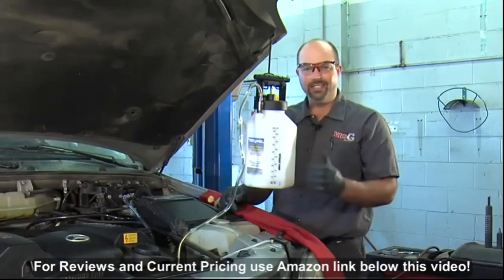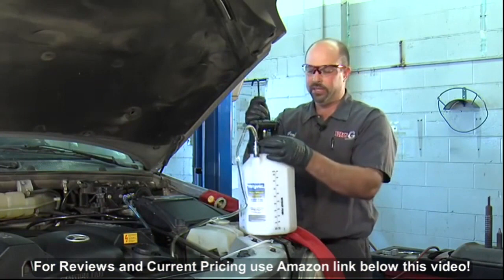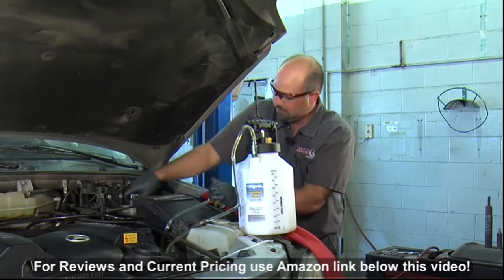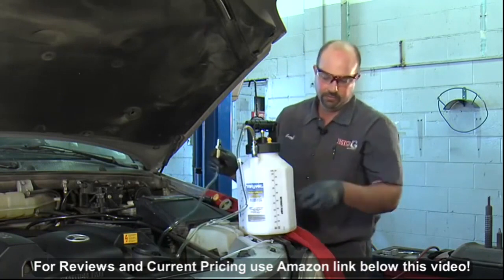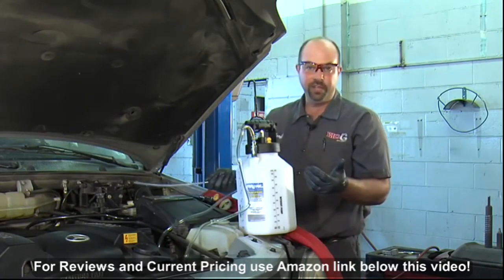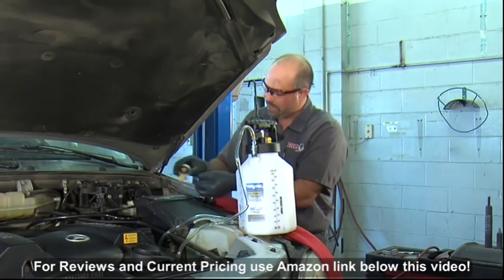We're done bleeding already — it's that simple. All I have to do now is relieve the pressure in the tank, disconnect our hose and our adapter. At this point, if you're low on brake fluid, it comes with this wand attachment. You can put that on the end of the hose, pump it back up, and fill it from there. We look like we're pretty good on fluid, so I'm just going to put the cap back on.